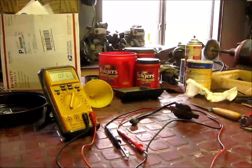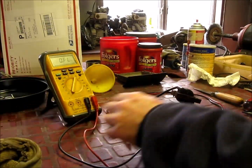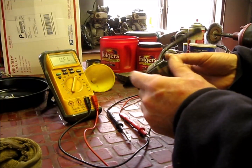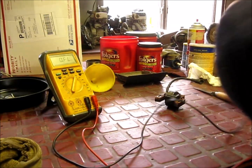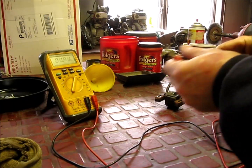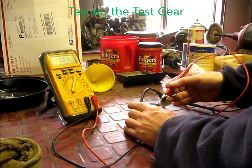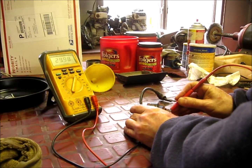Let's take a look at this coil. I didn't get a spark that I could see, and it just looks like your typical coil. I got a little oil on it from trying to get it off — it's a typical rusty coil. Let's see what we get out of it. We'll zero the meter; not strictly necessary but it's good to check the condition of everything. I'll use the alligator clip there.